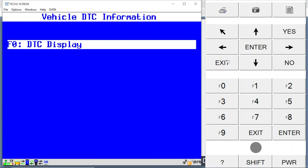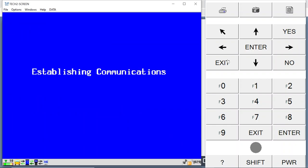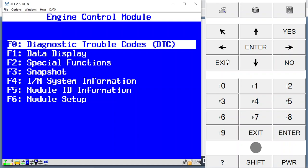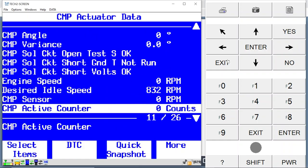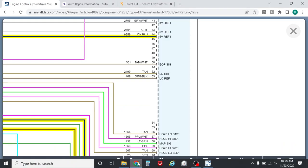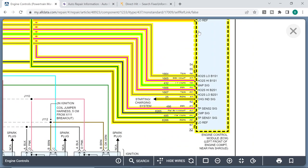Going all the way back out to powertrain. Here's our RPM — let's go ahead and crank this up. Still don't have anything. So at this point, it's time to get the scope out. We've got to check our 5-volt reference. What color wire was that? Dark blue, or was that a brown wire? Brown wire is our low reference. We probably blew that out of the computer.